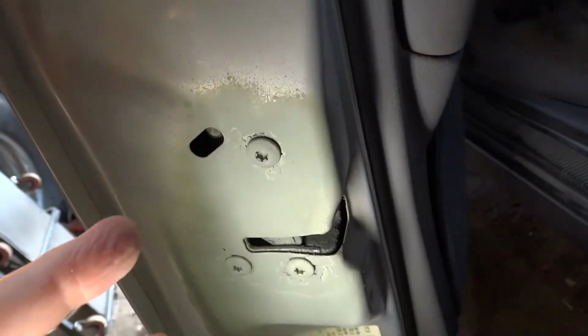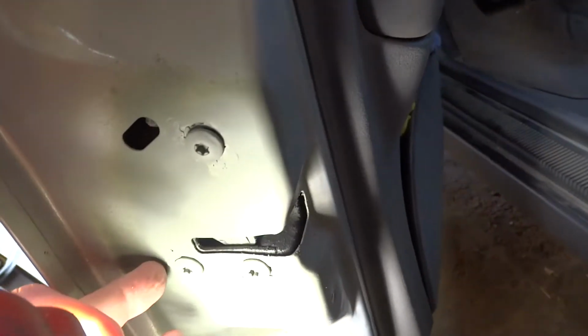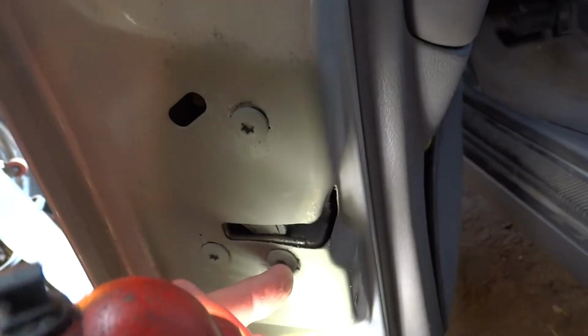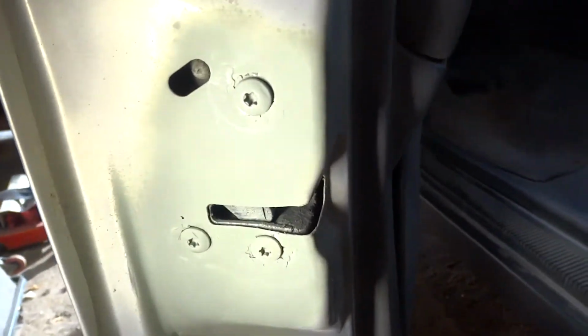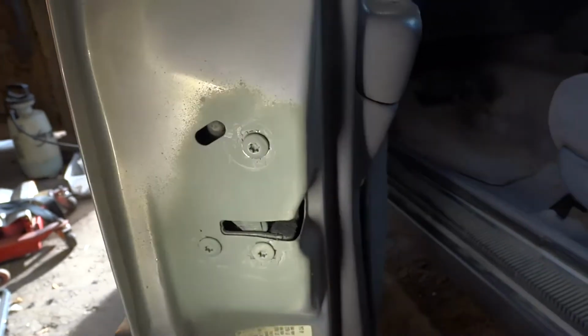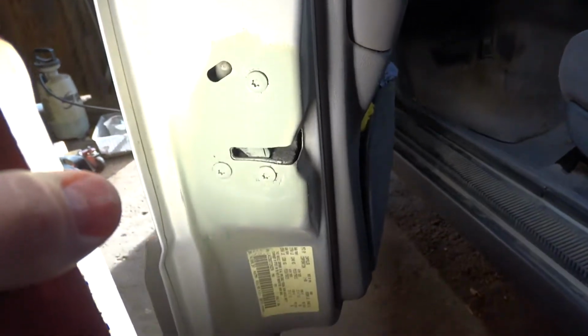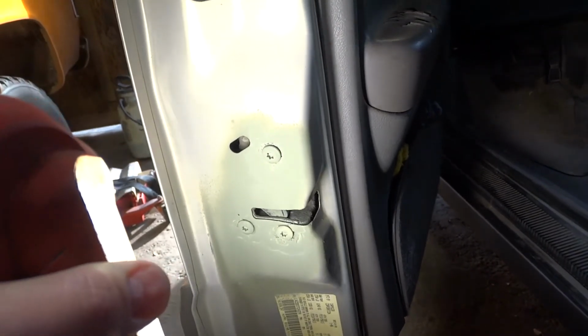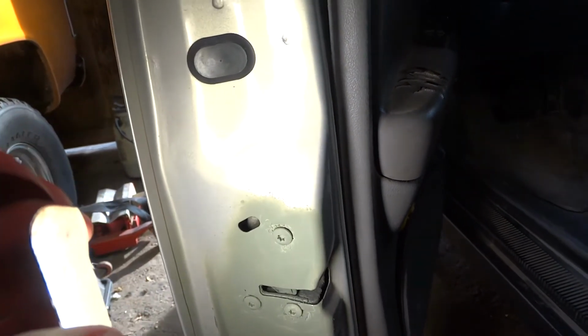Take the bolts loose, slide it back, leaving the bolts in. Take out the one bolt that you're going to weld around, and then weld around it, grind it down, put the bolt back in, go to the next, then go to the next. Now, she ain't pretty, and right now I've just got etching primer on it, just to seal it up and stop it from rusting, until I can find my can of paint.